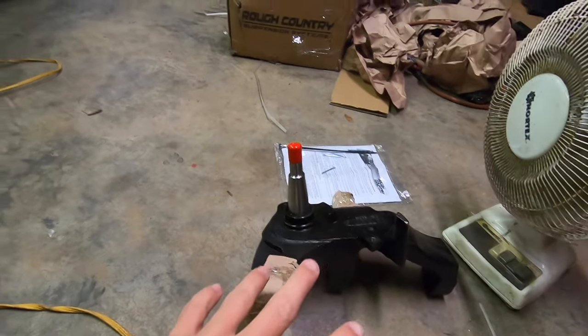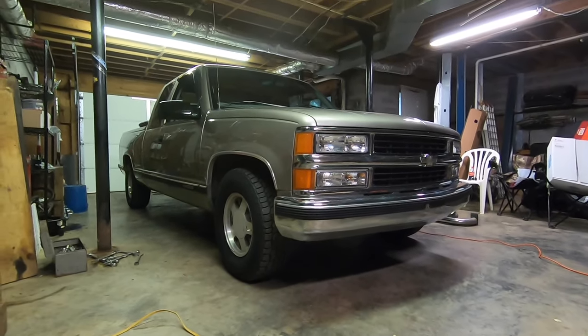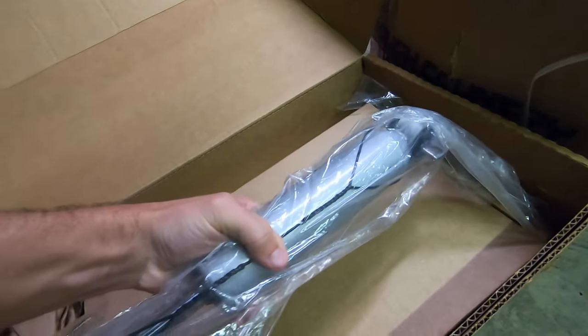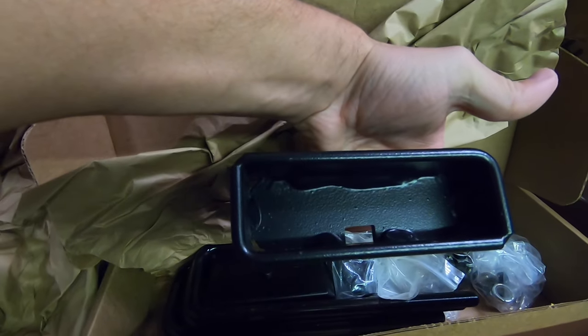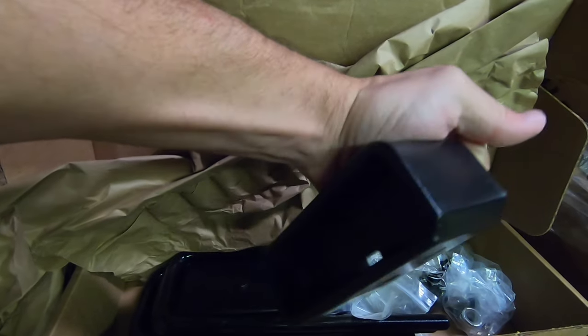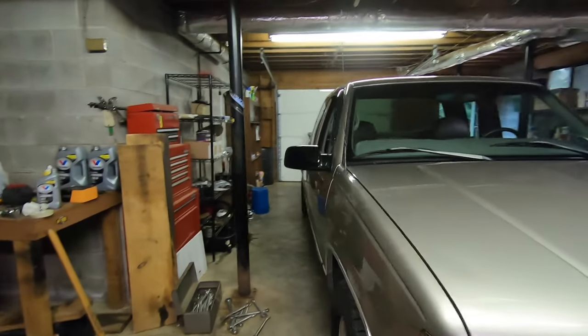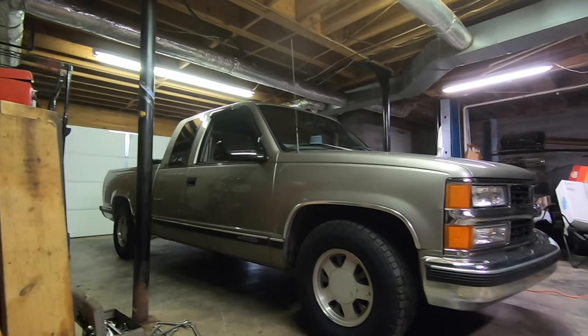I want to go a little bit taller than just this spindle lift, and I'll wait and do all those other components afterwards, because I want to see if these can go on just like I did with Larry using all the stock components and work great. I did get the full kit, but these front spindles are essentially what you're paying for. We're also going to be getting some new shocks, because the ones currently in there are stock and absolutely clapped out — these will probably make the truck ride even better. Then we have rear lift blocks, about a two-inch block, new U-bolts, new bolts, everything. For anyone new, the truck currently has two-inch drop shackles in the rear — technically about one inch of lift — just to give it a more leveled look.